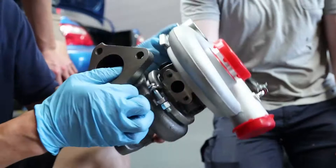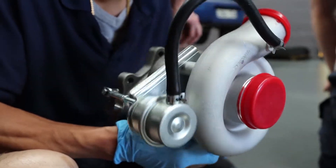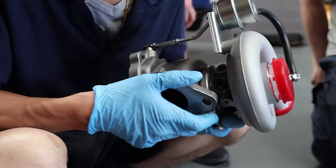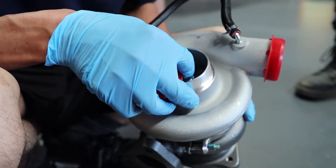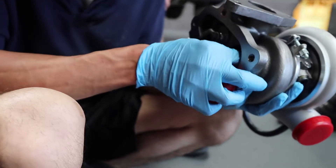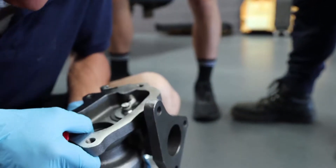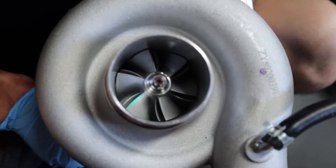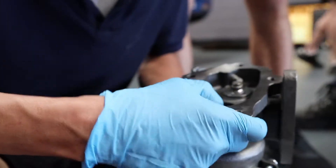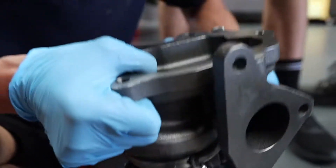Show us the Supra. So this is the Max Peding Rods turbo. It's very small, compact. But it's probably bigger than your current turbo though - yeah, it's bigger than my stock. The stock is a lot smaller than that. So we're just checking for shaft play - pretty good. Has it been balanced as well? Is there any shavings on the blades? So they've balanced the front as well, which is pretty good. The rears are usually not really required, but it's been balanced too.